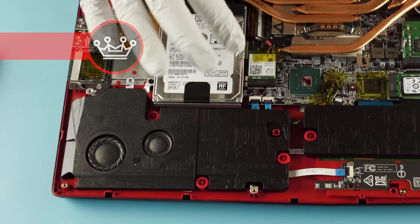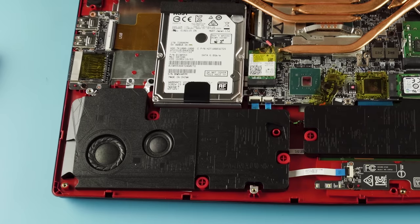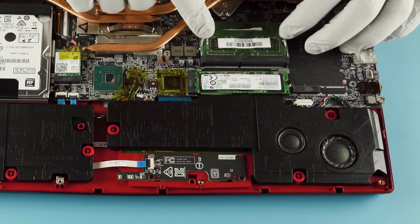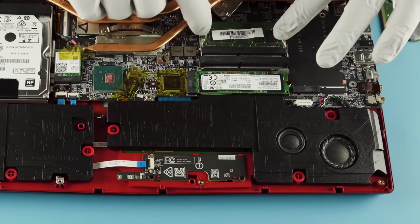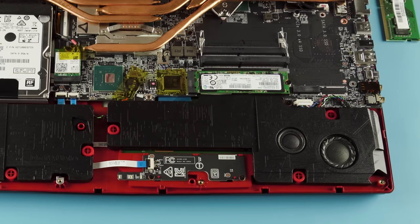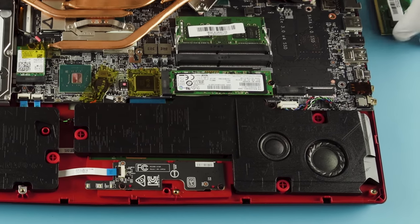Your CMOS battery is here. You've got your new 9-series Intel Wi-Fi here — don't know if it's any good, haven't really tested it yet, we'll figure that out later. Of course, your standard RAM setup here — two sticks. Pop it out, pull it out. It goes in at a 30–45 degree angle and then it just sits right back down and clips.